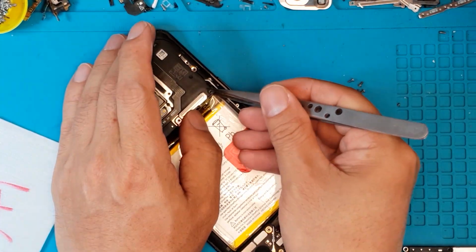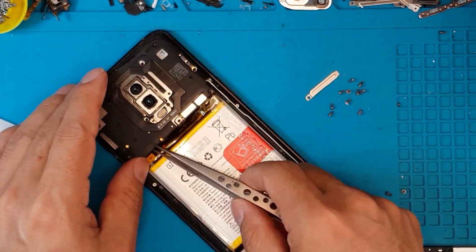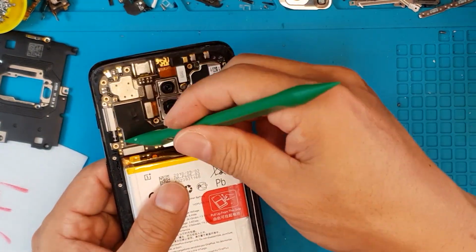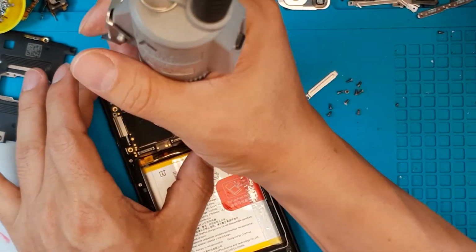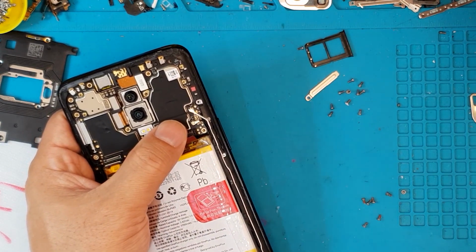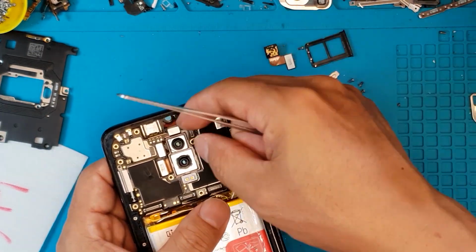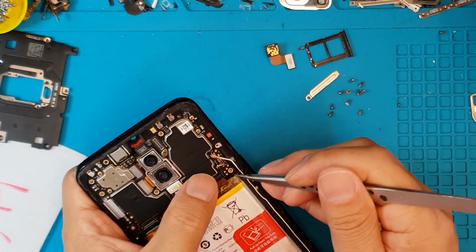So we're trying to remove the back plate, and we have removed it, and now we're going to remove the clips and the motherboard shroud, and then we're going to detach the battery and other connected electronics. So we're going to remove the SIM card tray and the antenna cables so we can extract the front-facing camera and the motherboard itself.